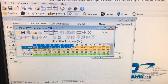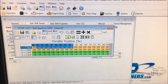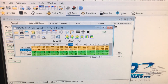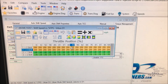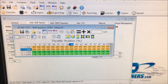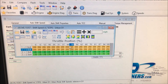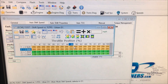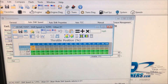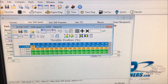Here's the catch: if you keep your throttle over 50%, it'll stay in first gear indefinitely. So all you need to do is change these tables to 255 — that's it. I'll flip back here to Project Steppenwolf so you can see that's all I've done. You just populate these tables with 255. You're obviously never going to reach 255 miles per hour in first gear, so if you've got your selector in D1 and all these tables set to 255, it will never shift out of first gear until you click it up to second.